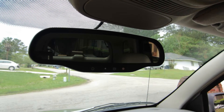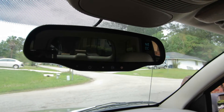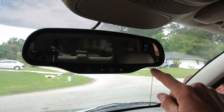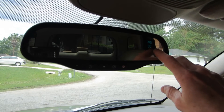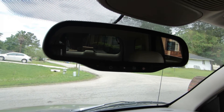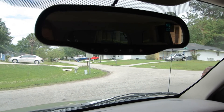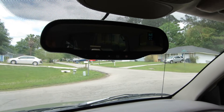Let's give this a try real quick. You can see we're already getting a readout from the compass. Because this is an electronic compass, we will have to recalibrate it for an accurate readout. But you'll notice on our temperature readout we're just getting 'OC' — that's for open connection. That is because this car does not have the wiring and sensor necessary for the temperature function, so we will have to add that now.